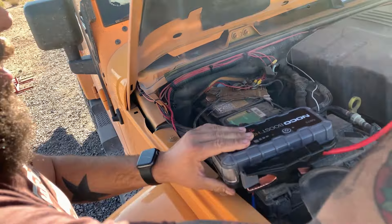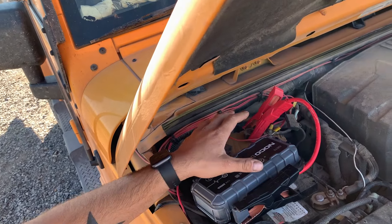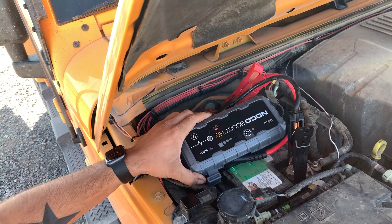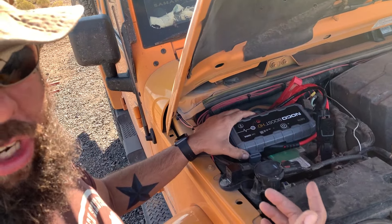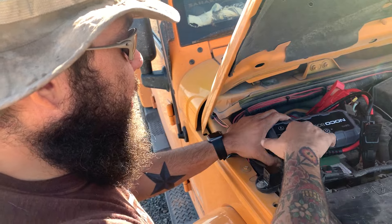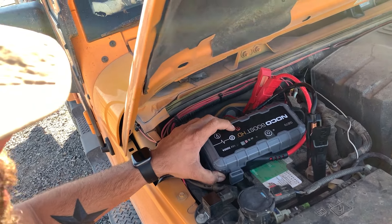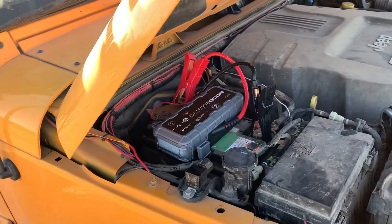So the first thing you're going to want to do is connect your positive lead — clip it onto the positive. Positive is red and that goes to red. Make sure you don't accidentally cross these or touch them to anything else. We'll go red to red, and then I'm going to unclip my black here — that's my negative — and hook that to my negative terminal. So now we're hooked up. One of the cool things about this jump pack is if you're plugging it into a battery that's just low but still has power, it's going to automatically sense it and put itself into jump mode. Since it doesn't detect a battery because I'm completely disconnected, I had to press this little red button — the manual override — to activate jump mode.